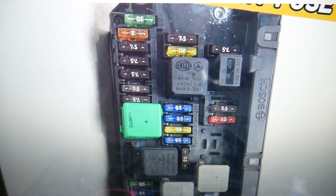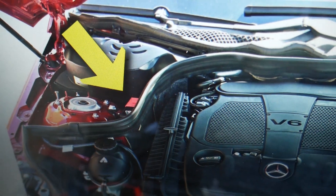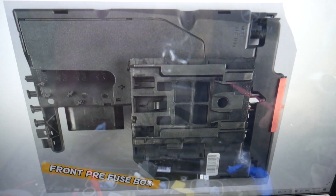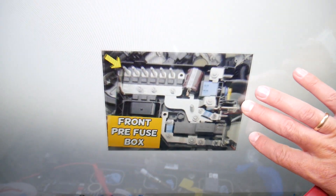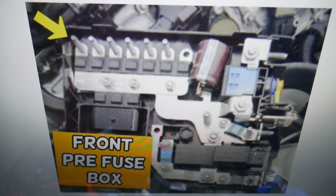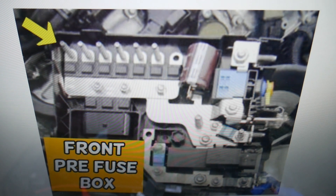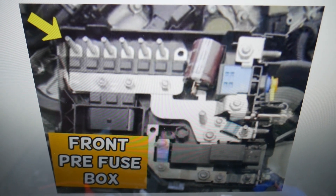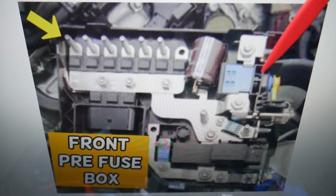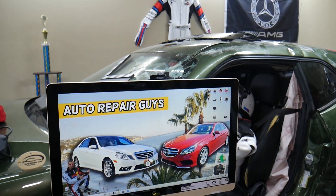After that, open the hood and where your jump starter terminal is located — that's actually a hidden fuse box. Here's what it looks like removed, and here it is opened up. On the inside they may look a little different — you may have up to three different ones depending on which model engine you have, if it's a hybrid, or if you have stop-and-go function. The fuse to check there is known as MR8. If you have any questions don't hesitate to let us know. Hopefully the video was helpful — see you guys next time.